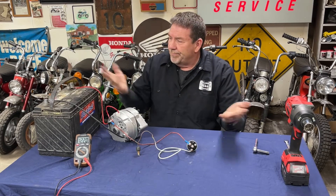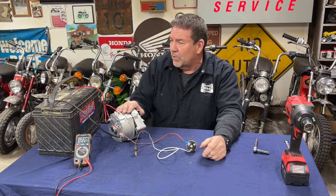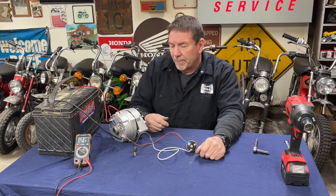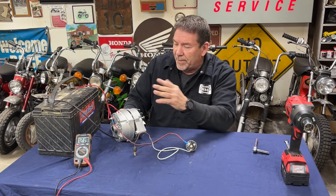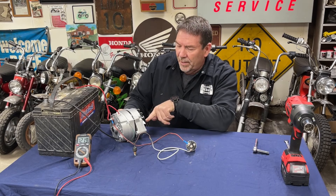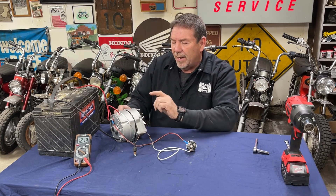Anyway, thanks for following along. If you need to put an internally regulated alternator on, you can put this in anything — tractor, vehicle, or whatever. This is the simplest wiring I've come up with to get it to work and actually maintain a charge on your battery. More Corvair content coming up. A Corvair is an odd duck to begin with — the engine actually spins the opposite direction of normal applications. In a normal application this alternator spins clockwise, but on a Corvair the engine spins counterclockwise. In a future video we'll actually be taking this apart and swapping out the fan blades so that it cools going the opposite direction. Look for that also. Guys, have a great day — I'll see you on the next video.